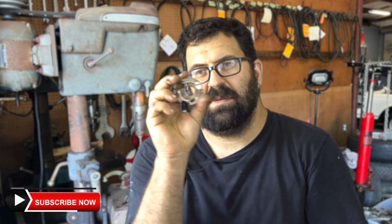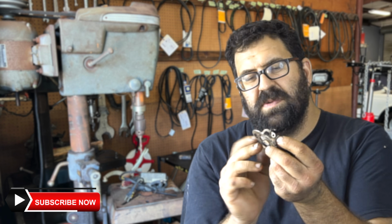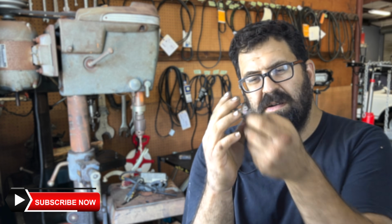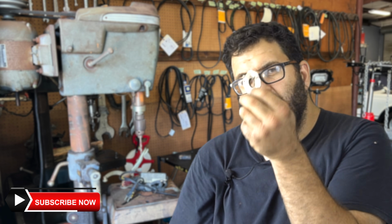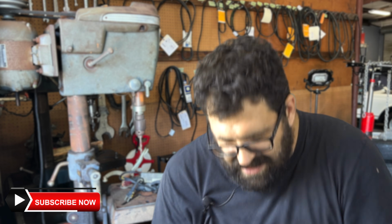Where the points attach, you actually have two parts to the breaker plate. You have the inner part, which uses screws that go through the distributor case to hold it on, right here and right here. And then you have the main part, or the points plate, which is what the points attach to.